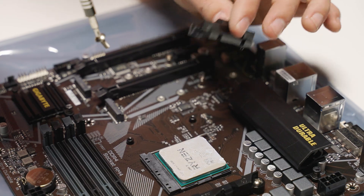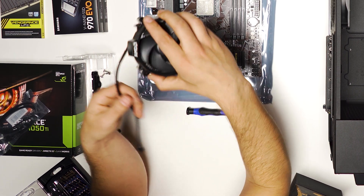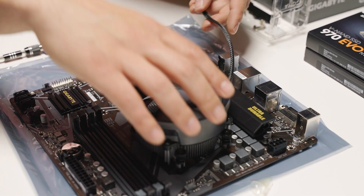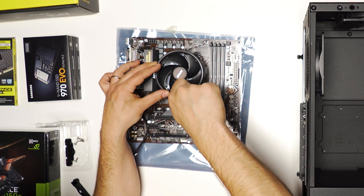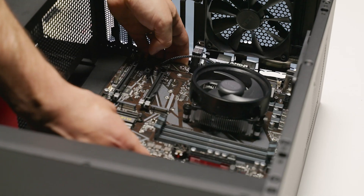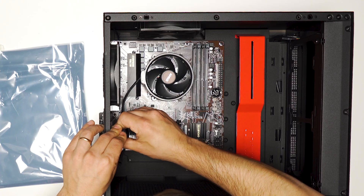Next, take off the brackets so we can install the CPU fan. This cooler comes stock with the CPU. On higher-end CPUs they typically don't come with a cooler, so you'd have to buy one aftermarket, but for this budget build we went with a CPU that included the cooler. Screw it in using a crisscross pattern to make sure it seats evenly. Then take the whole thing and put it into the case, making sure all the holes line up with the standoffs. If any standoffs are missing, there should be extras that came with the case.